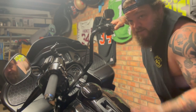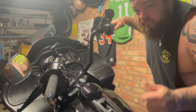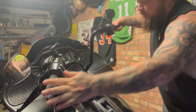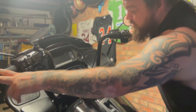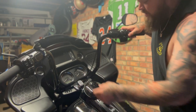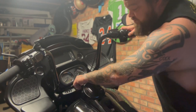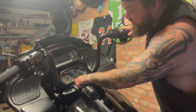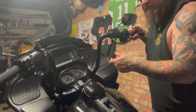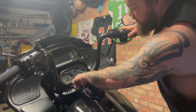I'm only showing you my bike but I know it does cross over into the other Harley-Davidson bikes with alarms. Let's go ahead and get this bad boy into transport mode. It's really simple — effectively we switch the ignition on for less than five seconds, the security light comes on, you need to switch it back off before the light goes out, and then hit and hold both indicators. You should get three flashes from the indicators.